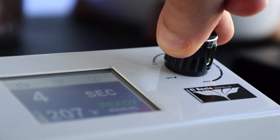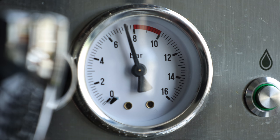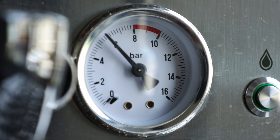Of course, all machines have their quirks and downsides, and the Czar isn't immune. After a couple weeks on the bar, I noticed a few things worth mentioning. The manual pressure flow is difficult to run accurately and consistently. Using a knob just isn't as tactile or rewarding as using a paddle or something similar. The pressure itself is controlled through vibration pumps, which aren't very consistent in how they build and maintain pressure — instead, they build and release over and over again, hence the up and down motion you'll notice on the gauge.